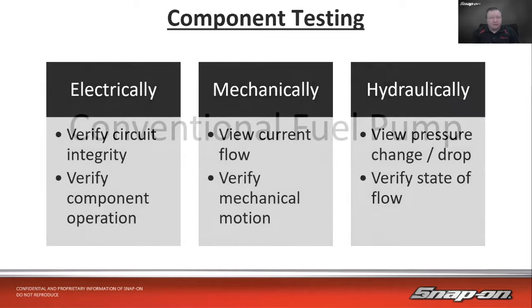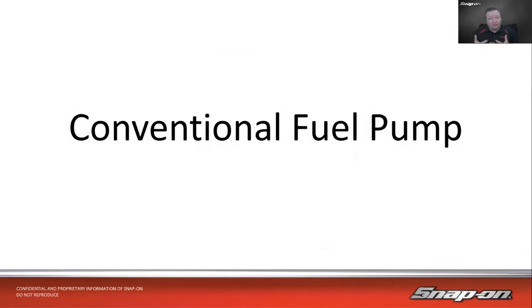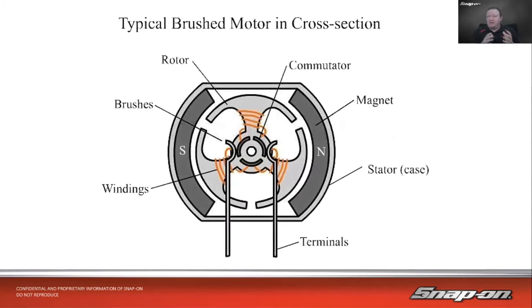We're going to start with our conventional electric fuel pump — we'll skip over the mechanical fuel pumps from the 70s and 80s for now. This is a basic diagram of a typical brushed DC motor, which is what they use inside a standard electric fuel pump. It has these things called brushes, which ride on what we call commutator segments. The terminals attach to power and ground. In this diagram we have three segments, though most automotive fuel pumps have eight commutator segments — we'll use that to do some math a little later.